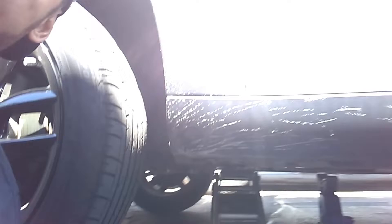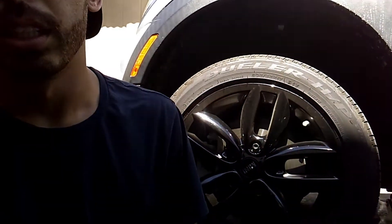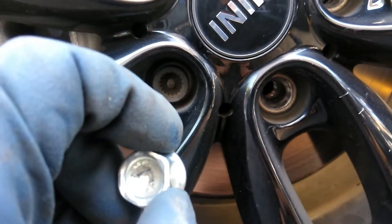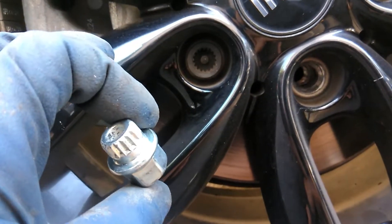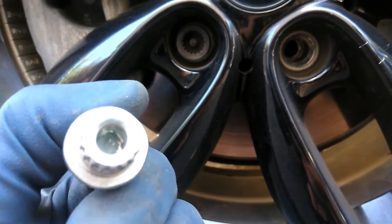Here's a good jacking up spot, and then you can put your jack stand right under there. If you don't have an impact gun, loosen up the lug bolts — 17 millimeters — before lifting. If you have an impact gun, just lift the car and loosen them up after. Also, each wheel has a special locking key, which you can find in your glove compartment. If you don't have it, locate your nearest Mini dealership or find one online — I'll try to post the part number in the description.